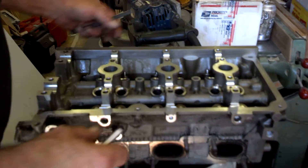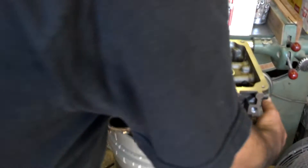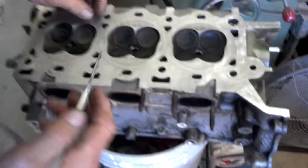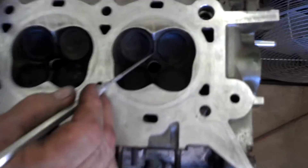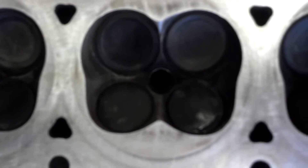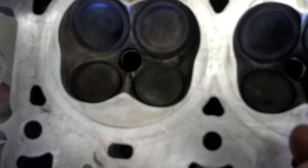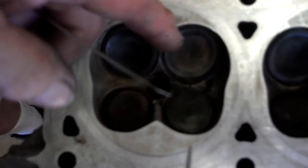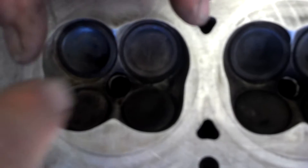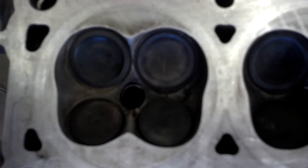Let's flip it and see the wear on the valves in question. The valves have a ride height and there's a big lip on them. This one is real thin if you can see the difference — this one's got a pretty good lip, and this one's real thin. Here's a hint: this one's black, this one's tan. The black cylinder is still firing; the tan ones are the two that were in question — they were not closing and you can see they've gotten hotter. They're barely there; you can barely get your fingernail caught on that lip, whereas the good ones have more of a lip. It's burned into the seat — seated deeper, which makes the valve longer.